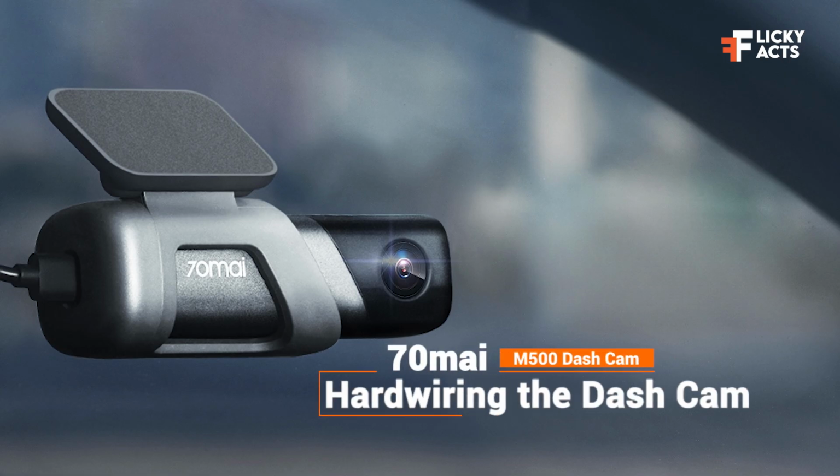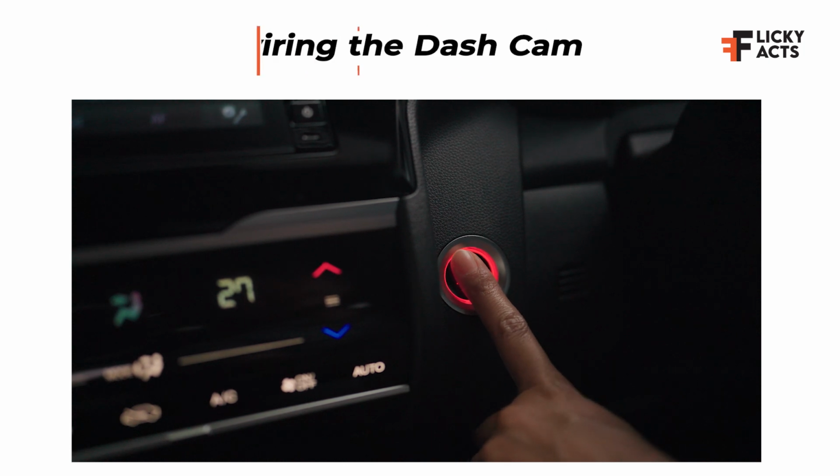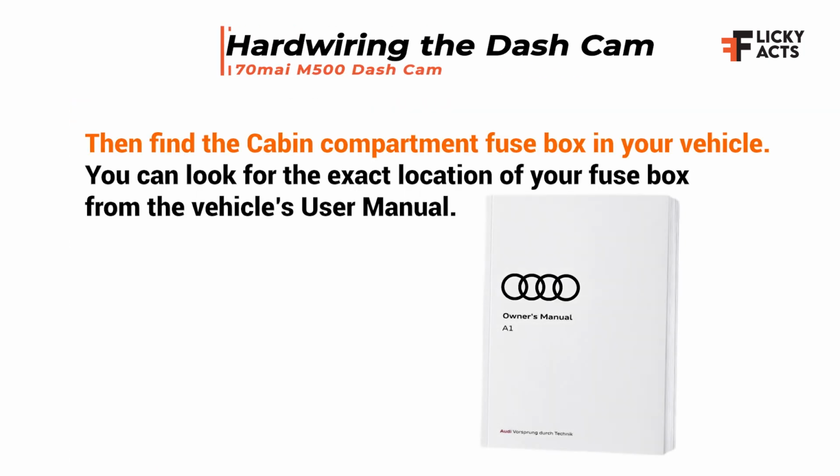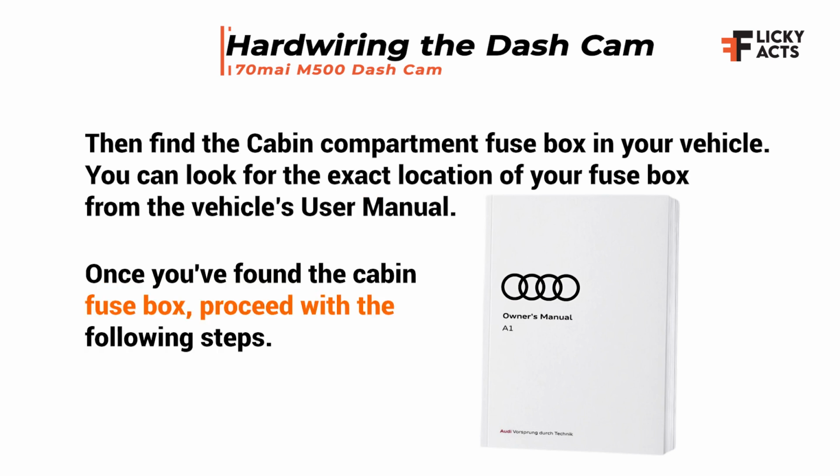Hardwiring the dash cam. First, turn your ignition off. Then find the cabin compartment fuse box in your vehicle. You can look for the exact location of your fuse box from the vehicle's user manual. Once you've found the cabin fuse box, proceed with the following steps.